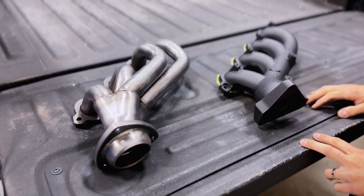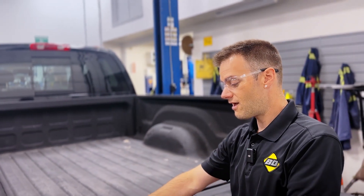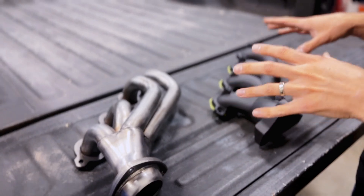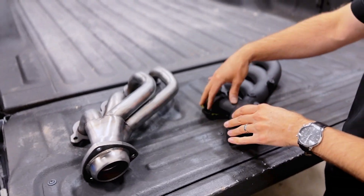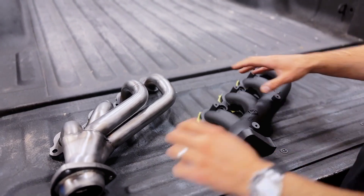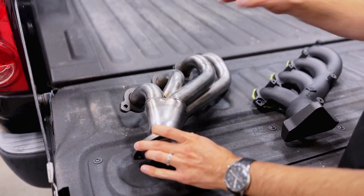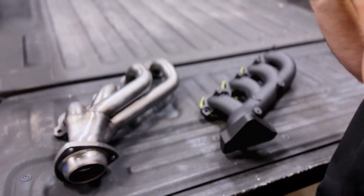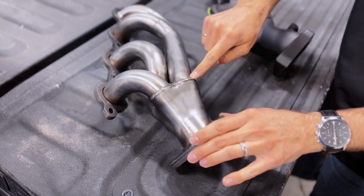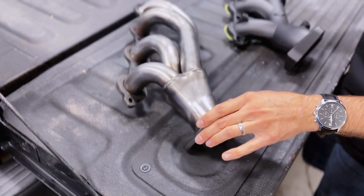With a cast manifold you have more freedom to flow the casting a bit smoother than when you have to jam the pipes together. One of the things to consider when comparing cast manifolds versus tube style headers is construction, style, and reliability. One of the main benefits of sticking with the cast manifold is the uniform thickness of the casting — they heat and cool more uniformly than a tubular manifold that has thin wall tubing and thick flanges, where you'll get different rates of heating, expansion, and contraction. Many of you already know and are yelling at the screen that these crack — yes, they do, especially at the welds. You get heat affected zones in the welds, especially up in the flange where you have thick meeting thin, and you'll crack tube headers. It's the thing that happens.